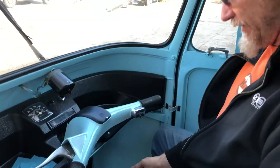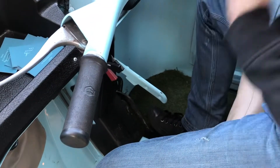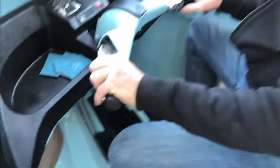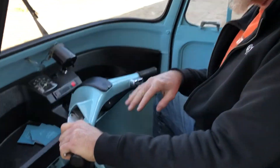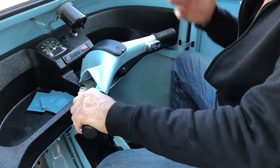For now, let's leave it in the up position. Go ahead and put your foot on the floor brake — that is the rear brake, actually it's all the brakes, so that's the hydraulic brake. Now you're going to pull the clutch in and rotate to first. First is backwards, then neutral is in the middle. Let's test it — let it out gently, and then second is down. That's second gear.